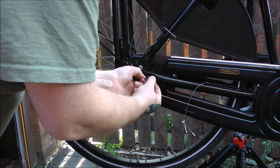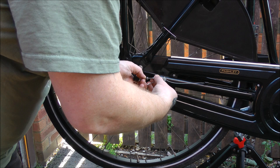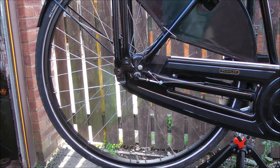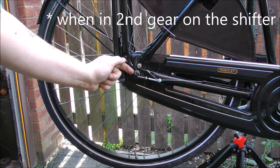Generally when I put the bike away after use I'll put it into top gear, so the cable or the spring inside the hub is not under strain. So that's in fifth now. I'll just make sure I put the cable end in — the yellow band I mentioned before. When you look through the hole the yellow band should just be flush with the end of the axle; that gives you good gear changing.